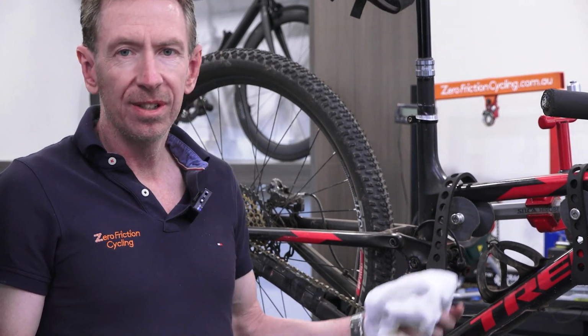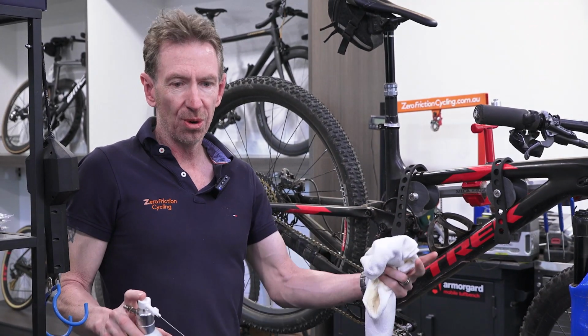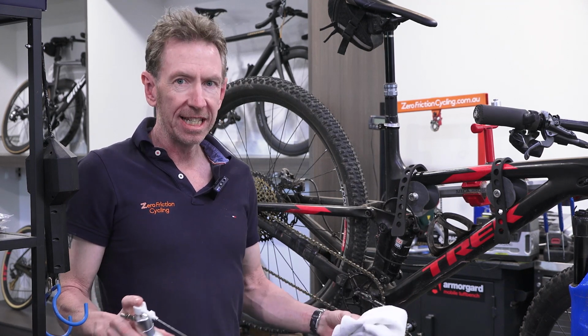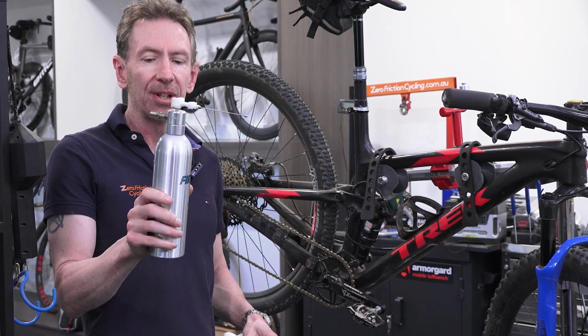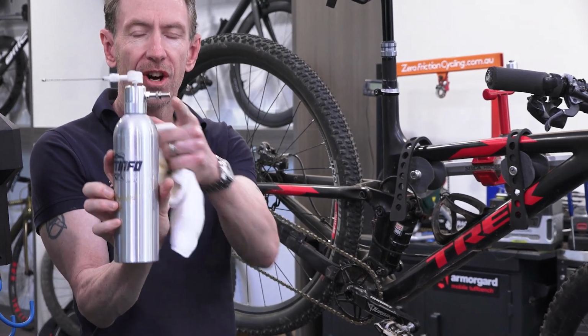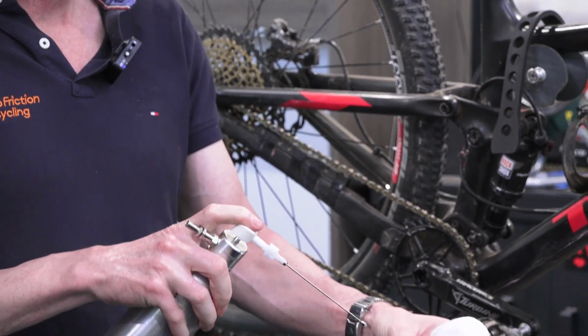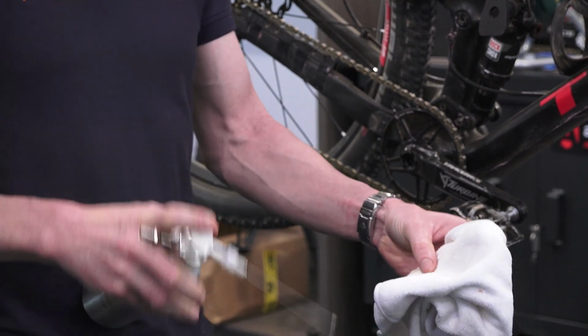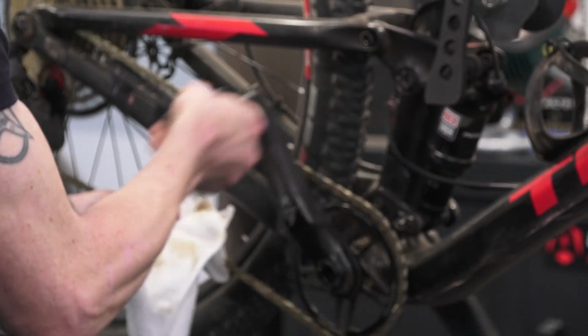Okay, so as per earlier in the waxing frequently asked question video, just showing how, if you're riding off-road, gravel, CX, mountain bike, whatnot, and riding out in the dust, and you want to minimize how much dust you bring into your wax pot when you rewax. One easy step for post dry dusty rides is to just spray a microfiber cloth with some methylated spirits. This is a cool little can. You may not have seen one of these, but you can pressurize it via your pump or air compressor. Saves you having to squeeze a bottle, so these are pretty cool. I just spray my cloth with some methylated spirits, and I'm just going to wipe the surface dust off the chain,